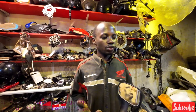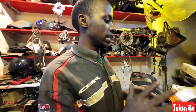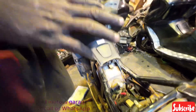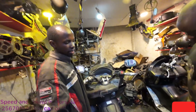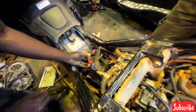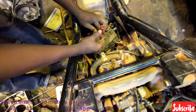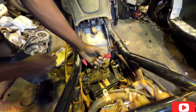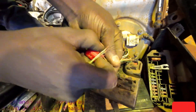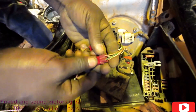This is a 250cc scooter. I'm going to take you through the initialization process of the gear system. First of all, we are lucky we have the body removed so you can see more clearly. Here on the battery case we are going to find a red service connector with four wires. We are going to loop only two wires — it has a blank cover. You will find a brown wire and a green wire with a black strip.